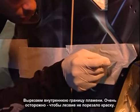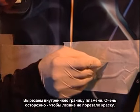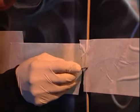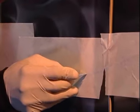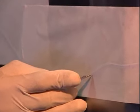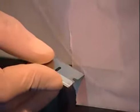And then I cut along here, and I'm going to paint on the inside where I want the pearl to be heavier. It's very, very crucial to make sure you have a brand new razor blade when you're doing this step, because if you slice into the pearl, there's no way you can really correct that, and you probably have to sand everything off and start over to get rid of those cut marks. You don't have to press too hard because it's a brand new razor blade.